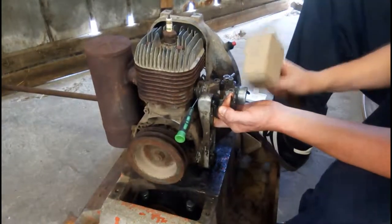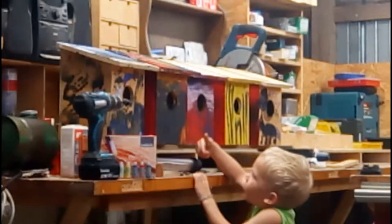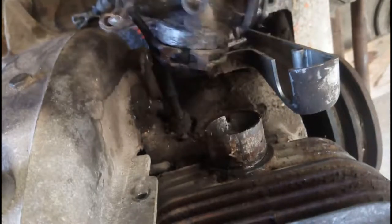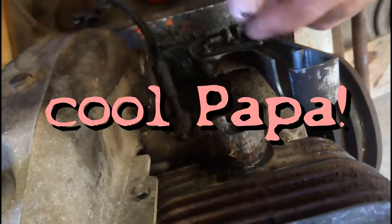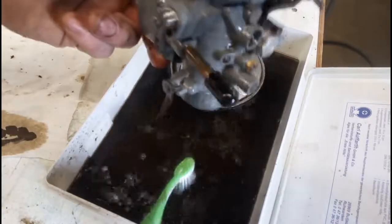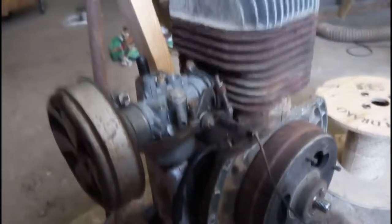At least I had some distraction from getting annoyed by it. I thoroughly cleaned the carburetor and the air filter with gasoline and the air compressor from the outside, then took it apart and did the same inside. After cleaning the carburetor, I fired the engine up and played with it around for a little while.